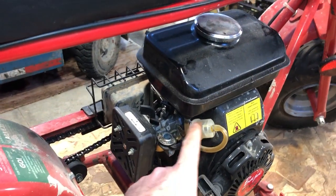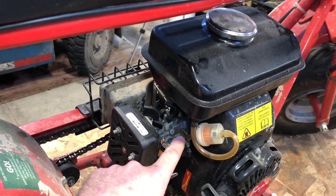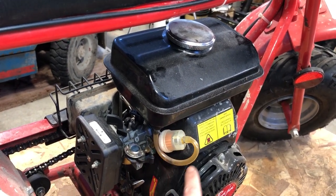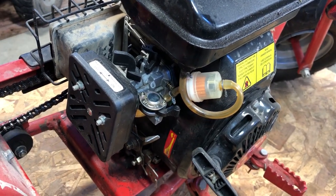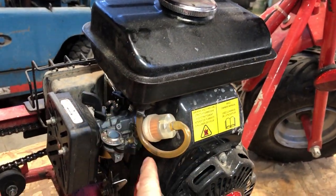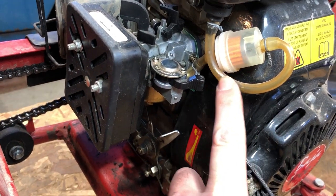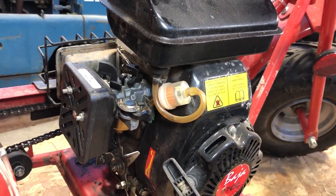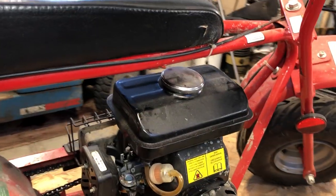The second thing I noticed was that the fuel tank had some rust and deposits at the bottom, and this bike did not originally have a fuel filter — just a small rubber line going straight to the carb with very little room for a filter. So after cleaning the tank out, I put in a transparent snowmobile fuel line, looped it to give myself room to get a filter on, and used some wire twist to keep everything snug. It's been doing a good job filtering out whatever residue remained, and the carb hasn't been taken apart since. One funny note: this low-end loop is acting a bit like a sediment bowl — there is some sediment accumulating in there over time.